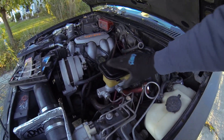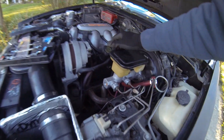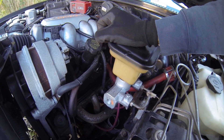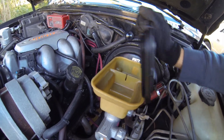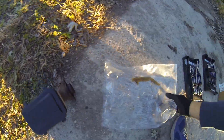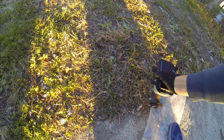The new master cylinder is installed — it's completely dry, I haven't put any fluid in it at all. The lid fits on real nice, way tighter than mine. Now I have to fill this with fluid. It's leaking some fluid out of the cap yet — there's still a bit in there. The fluid in the reservoir wasn't terribly dirty, but it's not totally clear either, which it should have been.